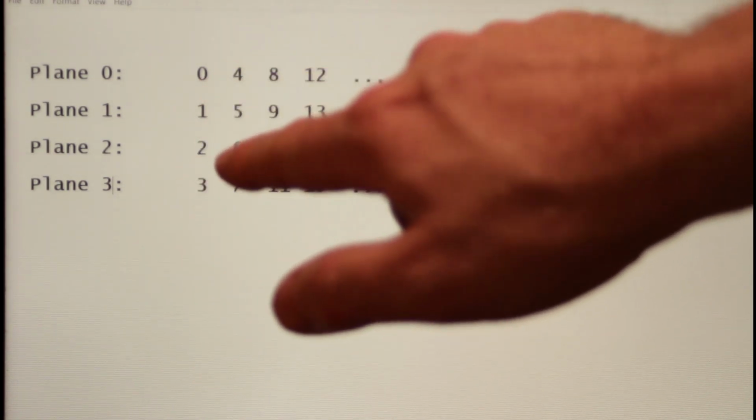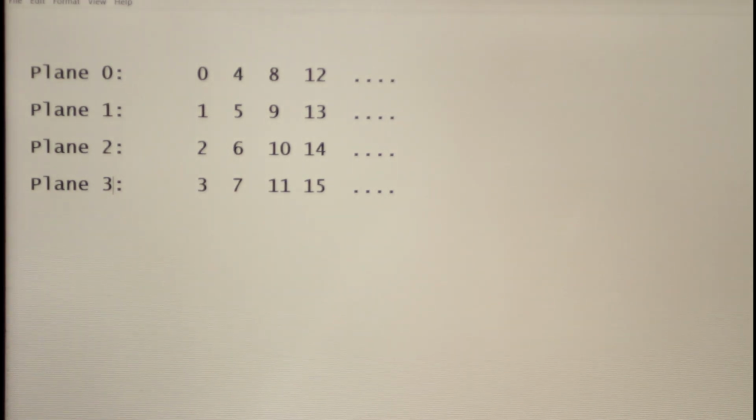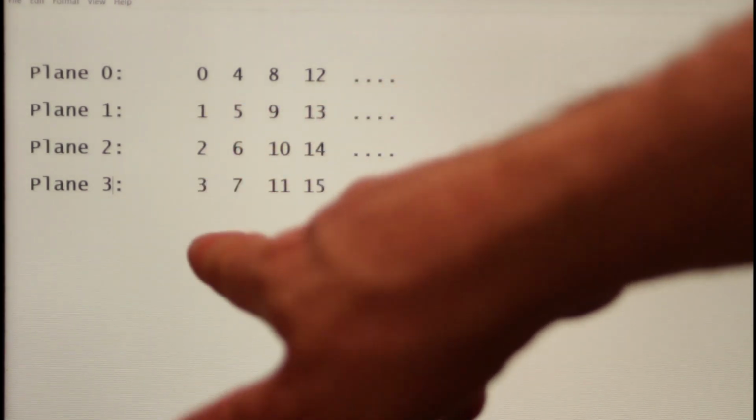Now this might sound complicated, but after a bit of mathematics you can check that it has the effect of making it seem like all the pixels are in linear order in memory. This will be address 0, this will be address 1, 2, 3, 4, 5, 6, 7, and so on. So this emulates precisely the way that MCGA worked in, say, the Model 30, in that your 64K address space now corresponds to each of the 320 by 200 pixels on the screen, all in linear order. Now there's a downside to all of this, of course, and that is you've now thrown away 2 bits of your 64K address space. You're using those to select a plane, and that means in total you can now only access 64 kilobytes of video memory. Now that's different in the other planar modes like Mode Y, where you had 64 kilobytes per graphics plane.